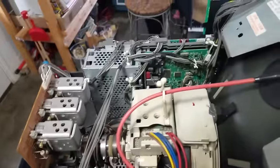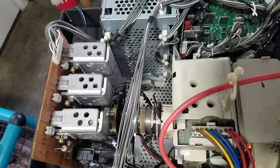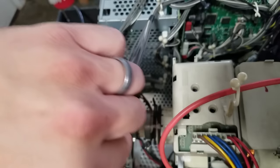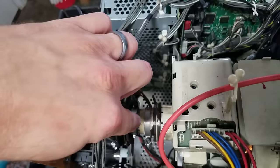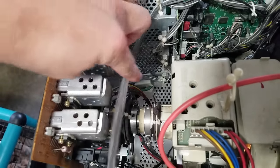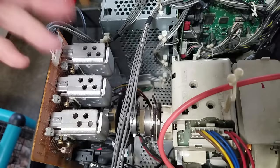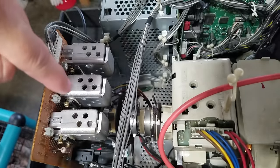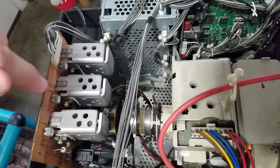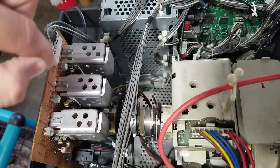There is very little space — a lot of stuff is cramped in here, unlike past models where we had more room to work around. Looking back here, you can see the CRT gun area, and you'll notice the convergence rings are actually separated: two here, two here, and another set of two. That's probably better for making adjustments since you won't accidentally hit the wrong rings — in other CRT setups, six rings are usually all stacked on top of each other. We've also got a neck board with potentiometers, likely manual controls for color.